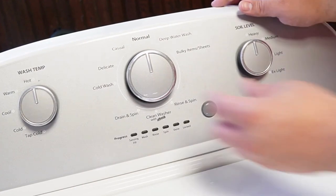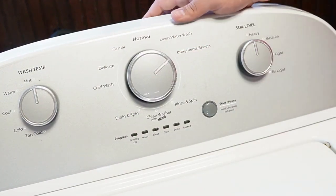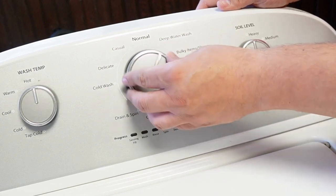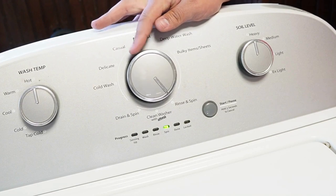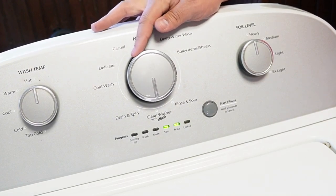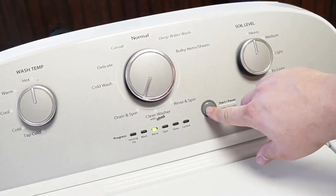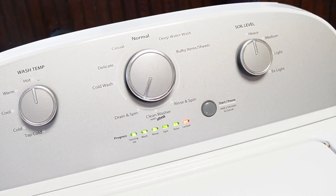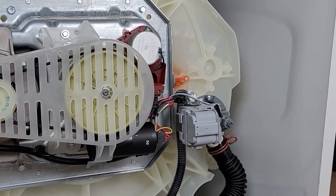Now let's attempt to recalibrate through the calibration mode — a must-do if you've installed any new parts, from a board to a balancing rod. With the washing machine freshly rebooted, rotate the dial counterclockwise 360 degrees, then turn the knob right three clicks, left once, then right once again. Do all these things within three seconds. If done correctly, all the lights at the bottom of the control will flash on and off, showing you've entered diagnostic mode. Then turn the knob clockwise four times until the rinse light is the only one illuminated — this is recalibration mode — and press start.